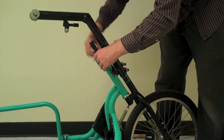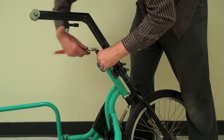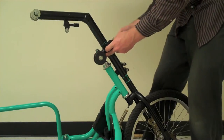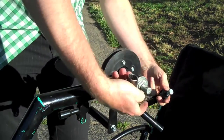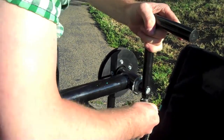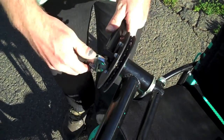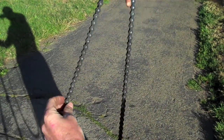To install the stem quill, first put it into the steer tube, tighten the bolt with your fingers so it doesn't fall in, and use a wrench to secure it at the height desired. For the right side drive, make sure that the groove in the bottom bracket spindle is lined up with the bolt. On the non-drive side you have an option of putting the cranks in phase or out of phase — in phase is your hands moving together, out of phase is your hands moving opposite. Many riders prefer in phase for smooth level ground and out of phase for rough terrain. Make sure you tighten these bolts very securely with a 17 millimeter wrench. If the chain is tangled, make sure to detangle it into one loop before installation.